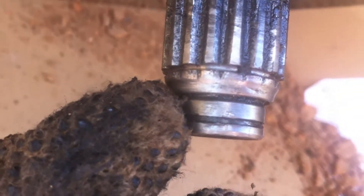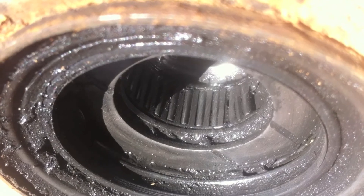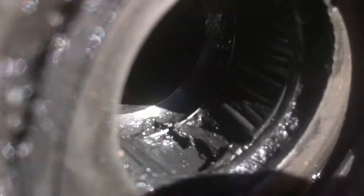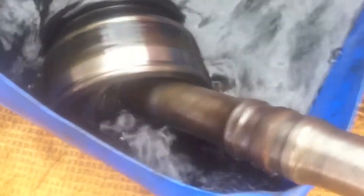What I was actually looking at was the last place the hub chewed the splines up on the outside of this axle. It's supposed to be a nice smooth needle bearing inside where the axle goes through, but this one's been run with the clip broken off the end. You can see the needles are destroyed, the bearing is destroyed. You can order that part and a new seal, maybe a new thrust washer — but in this case I'm just going to replace it with a good used one. I'm degreasing this axle right here, getting it prepped for new boots and new grease.